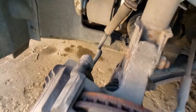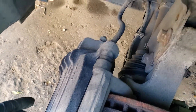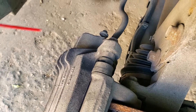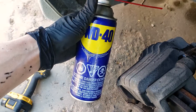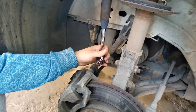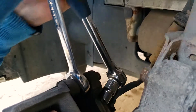The other side was kind of a problem, so we're going to WD-40 that and let it sit for several minutes. WD-40 is an all-purpose penetrating oil and lubricant — it usually does the trick for a brake job. There's a top bolt which is 12 millimeters and a bottom bolt which is 12 millimeters, and then there's one here which is 18 millimeters, so you have to hold that one with a wrench while you undo the other. Now we'll use a 12mm socket and an 18mm wrench and see if we can bust those loose.